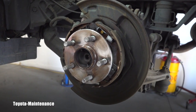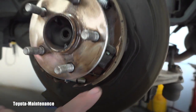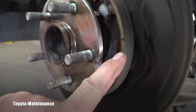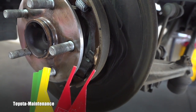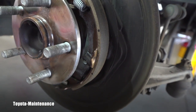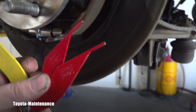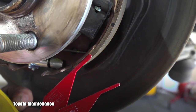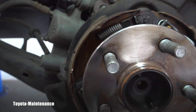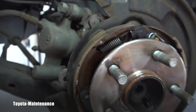I'm very lucky I don't have to deal with it. The only thing I'll be using is this adjuster, because it wasn't adjusted correctly. However, the shoes seem to be almost brand new. Using my gauges, the smallest is 2mm but these are definitely larger — I believe these shoes are comfortably 3 millimeters, and in this case that's perfect. It's not a problem at all.